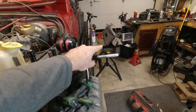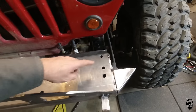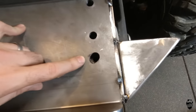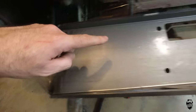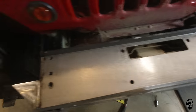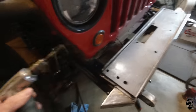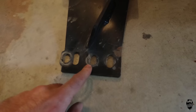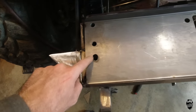So let's put the bumper on and test fit it. The test fitting looks pretty darn good. I'm happy with the way everything turned out. I did have to kind of elongate these two lower holes a little bit to get the bolts to line up, but these two are perfect, these two are perfect, and then those two lower ones just a little bit. I had to oval them out with my carbide bit on my angle grinder. Even the old winch plate mount had mounting holes that were way ovaled out, so I don't feel too bad about only two of eight being a little bit ovaled.